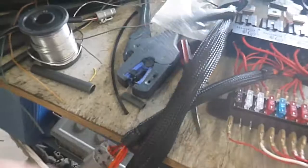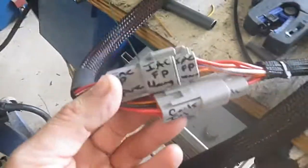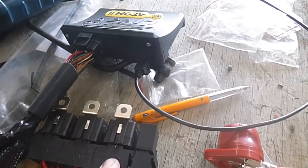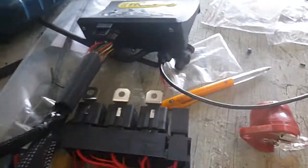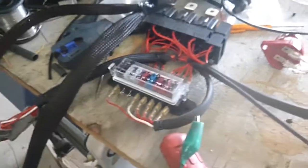I've given you a little bit of extra length for the power wires going to the fuses and relays, and they plug in — you can't get it wrong, they're actually even labeled, so that's real simple. Box lid goes on. Relays: fan relay, fuel pump relay, ignition relay for the coils and injectors, and the EFI or computer relay — that does the computer and the idle speed control. I know Rob said he doesn't want it. But I put an OBD2 plug on it, which is handy if you want to put your scanner on or you're in the middle of nowhere — you can get one of those dongles, put them through your phone, clear some codes. Real simple.